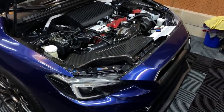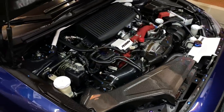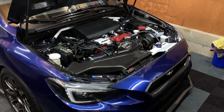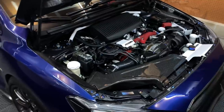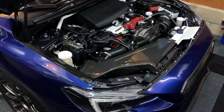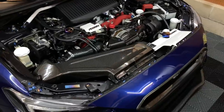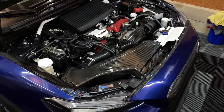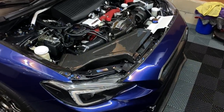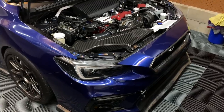So they're going to be installing that as well. I'm also going to be converting over to 5W40. As you guys know, I've been running 5W30 for the entire length of ownership of this car, mainly because I was pretty much running stock power and wasn't doing anything crazy. But since bumping up to Stage 3 and running the extra power, I wanted to run a little bit heavier weight oil just to keep the motor a little bit cooler and a little bit happier. I'm still going to be using Motul — that is my oil and fluid choice for this car. They're going to be changing the filter and basically doing a full oil change with the whole oil pan kit install.